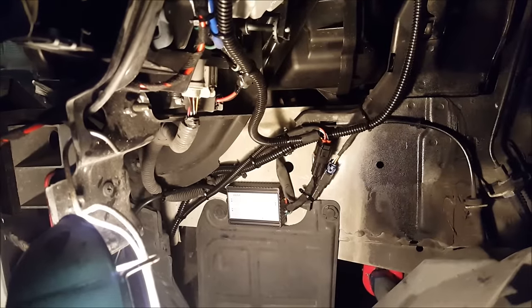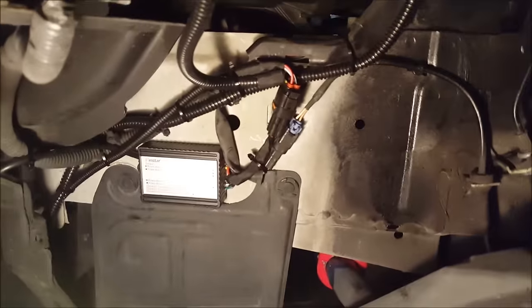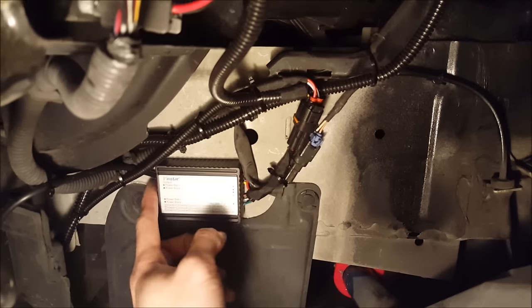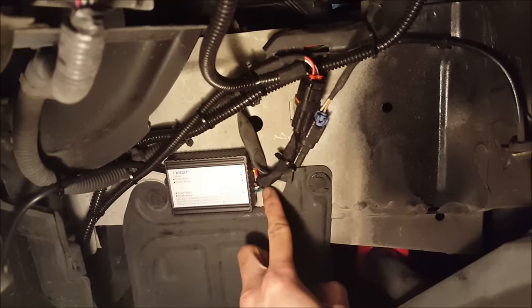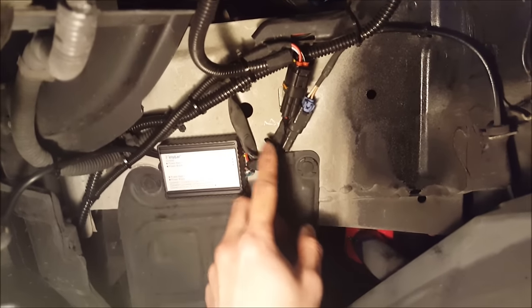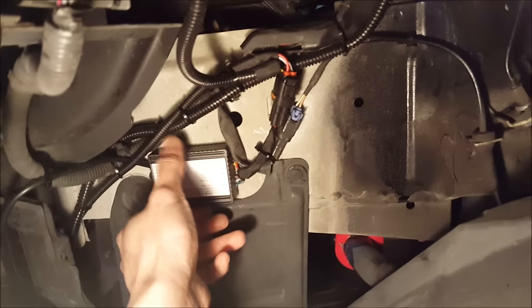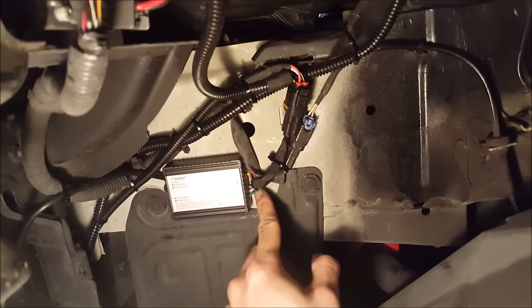Here's the left side all done — the driver's side — and yes, it looks way better than the right side because we have so much more room over here. The module is right there. I only put in one screw because this tab is wide open and not near any wires. I didn't bother trying to hit the other tabs because you can't unplug these wires — it's sealed to keep it water resistant. If you try to fire a screw in there you're probably going to pinch the wires. If you're really concerned about mounting, you can build another bracket with a rubber insulator. Don't try putting screws on these tabs.